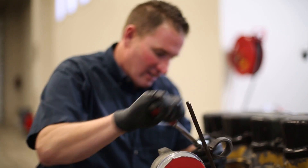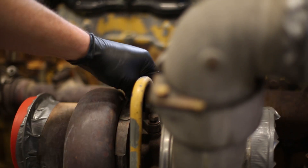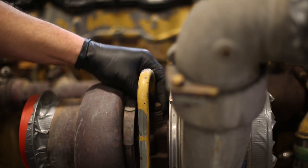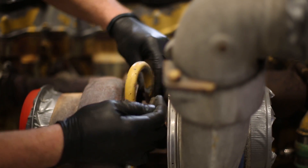We're going to take the oil pressure line off using two different crescent wrenches. There's a fitting and a swivel nut — we'll hold the fitting while turning the swivel nut. Make sure it's all the way off and flex it off to confirm. Then grab a 9/16ths wobbly with a 3/8ths drive ratchet to take off the oil pressure line. There are two bolts and one jam nut that holds it — you'll be reusing these 3/8ths bolts.